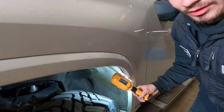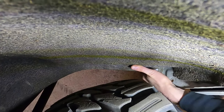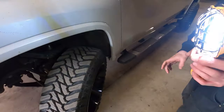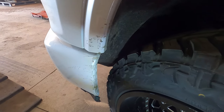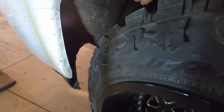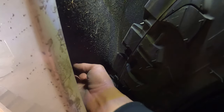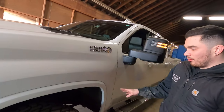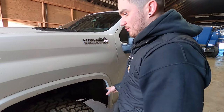Right now you can see I can fit my hand in between the liner and the fender. Turning the other direction, my restriction is the liner — it would come down right here and hit the tire. That's why I modified it. There's a bracket right here that I trimmed and I was able to pull this up. Look at this before you make any adjustments and make sure that you have room to go down.